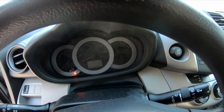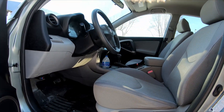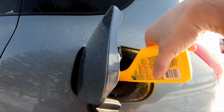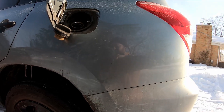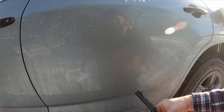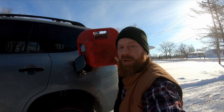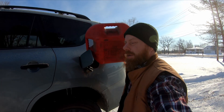It runs, so I think we better put some fuel in it and maybe some gasoline antifreeze. We'll add some dry gas to it just in case he got a shot of water from somewhere. I have to believe that if he did, it would still be frozen. It did start a moment ago, so we'll do that and add some fuel to it. Let's not give him too hard a time — he's only had it about two weeks. The fuel gauge probably isn't as accurate as it should be. We're gonna add four gallons and fire it up, let it run for a few on the trailer.